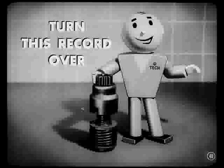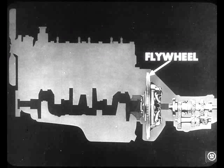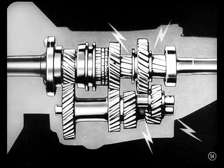Now let's cover the clutch disc. Dan: I know a clutch disc ought to be replaced when it's worn out — the disc just works when you shift gears, right? Pete: The clutch disc works all the time the car's in motion. The flywheel smooths out the normal power impulses of the engine, but doesn't take out all the vibrations — some can reach the transmission. Because clearances must be maintained between transmission parts so you can shift gears, torsional vibrations coming from the engine can cause sympathetic vibrations in the transmission, making those parts vibrate against each other and producing noise. That's where the clutch disc comes to the rescue — it smooths out those torsional vibrations so power flows evenly into the transmission.